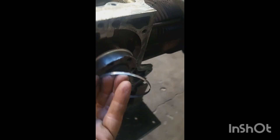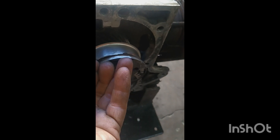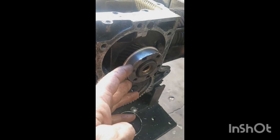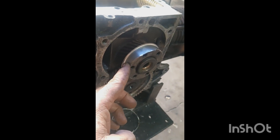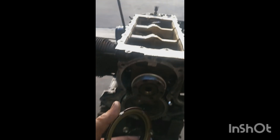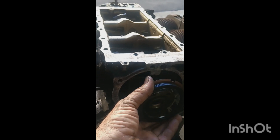You just kind of cut off some of it and then grind off the rest carefully using a grinder — a little grinding wheel or cutting wheel — and get the burr off there and make it flush.